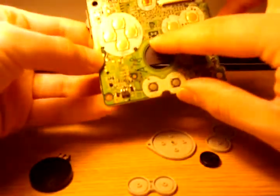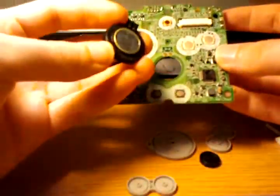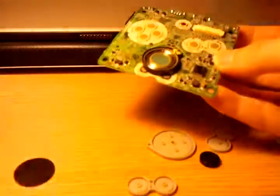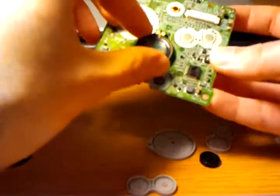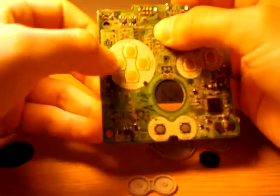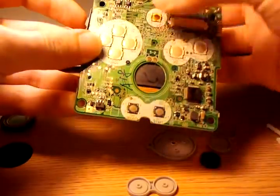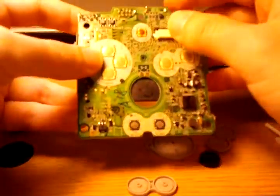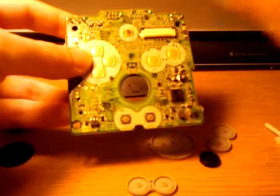You have your surface-mount pad contacts for the speaker, which rests at the top of the case with little protruding metal pins. The speaker is covered with a material to keep dust out. Other than that, you have your backlight switch. The original one would flip it on or off, but this one, because of the backlighting — it's not trans-reflective — you can barely see the screen without backlight. So it switches between two levels of brightness, a low and a high.